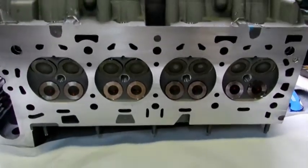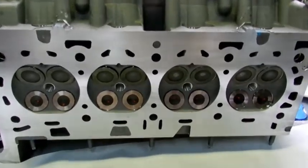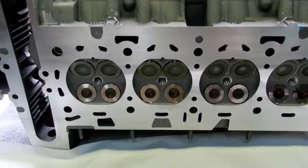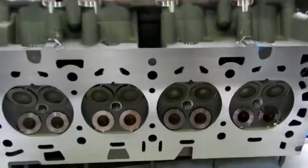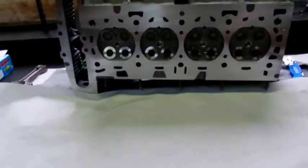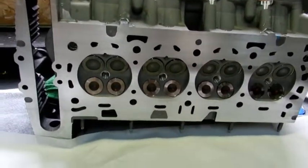This is a brand new head which can be purchased from GM for around 400 bucks, including cams, new valves, springs, rockers — everything. Just buying the updated rockers alone was about 180 bucks. I've already had this apart and installed my updated Super Tech dual 75-pound valve springs.